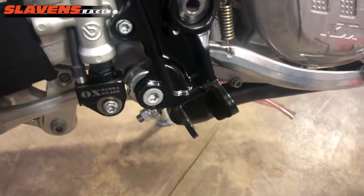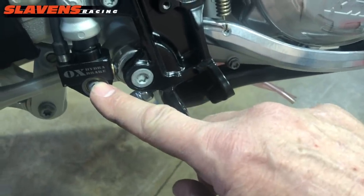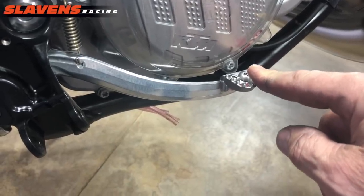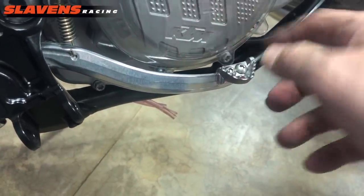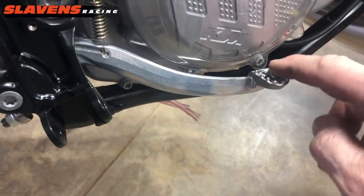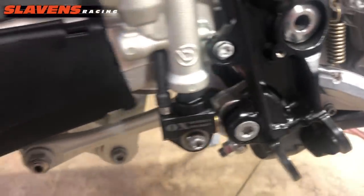So I need to make one little correction. I misspoke and said that you can adjust this once it's mounted onto the pedal — that would be very difficult to do. So it's much easier to just remove this bolt and make your free play adjustment. Once you get it on there, go over here and check your pedal and make sure you have free play. Free play means that the pedal moves before it engages the brake pads. Just make sure you have free play or the system will fail — it'll overheat and fail. Just pop this bolt back off, make your adjustment, then pop it back on and you're done.